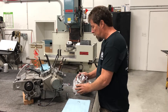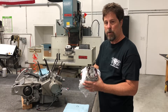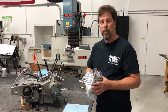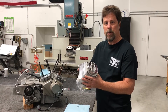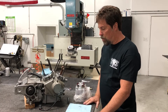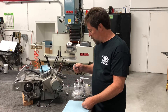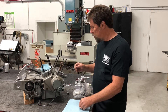What I have here is a cylinder with the piston already installed. The rings are already installed and the ring gaps are set. There's an entire section in the installation instructions on the website about how to set the ring gaps. There's also lube in here, which is very important. More than 90% of our customers purchase this service from us, so the cylinder comes to them inside a plastic bag with rings and piston already installed, ready to go, and even one circlip is already installed into the piston. One of the most common questions we get is, where are my circlips? Customers unpack everything, find the wrist pin and a little baggie with two circlips, and think we've shorted them. The other two are already installed in the piston for you.